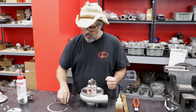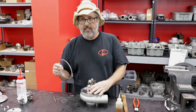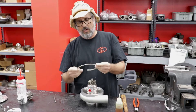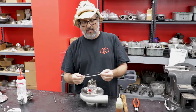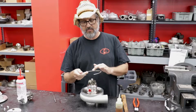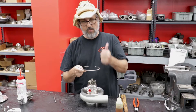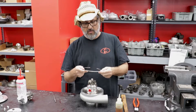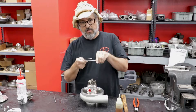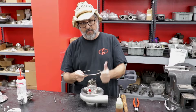Get it at the right angle that you want the compressor cover oriented relative to the oil inlet and oil drain. The snap ring has a top and a bottom — the bottom is flat, the top has a chamfer. The chamfer needs to go away from the compressor cover. The chamfer is what holds the cartridge firmly in, so in this orientation the chamfer faces up.